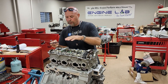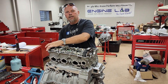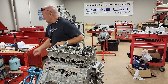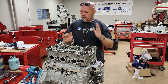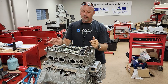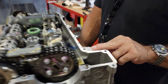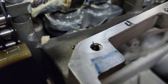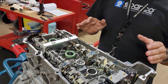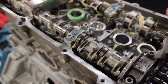If the cams are in phase, you can properly time — the tool should slide in. Sometimes you've got to give a little bump with your hand, but it should go in fairly easy. I want to talk about a couple of other things also when you're doing these jobs. Each cylinder head on an M96 and M97 has a unique cylinder number on it. This one happens to be 62021. The valve cover will also have that same number, which is unique to that cylinder head.